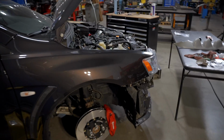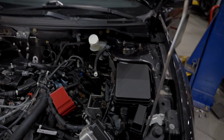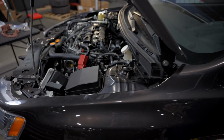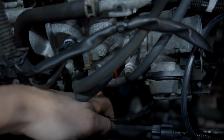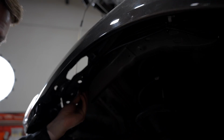And then once we have everything hooked up on the car side, we can plumb it all up into the pillar and into the gauges. All right, we've got boost here and oil pressure all plumbed up, if you can see that. Not really, kind of, sort of. So just kind of tidying things up in this fender well. Do the best you can to tie it to some of the factory stuff going through here behind the fender liner and then into the car there.